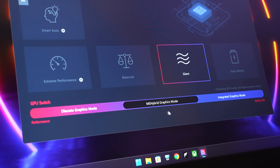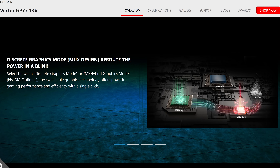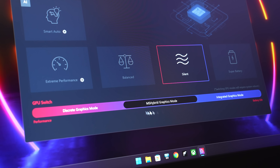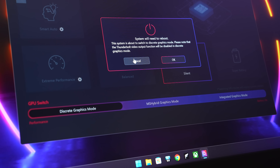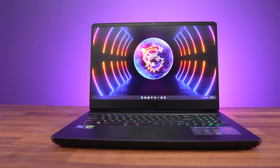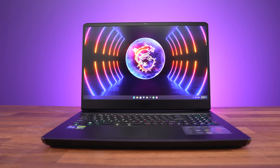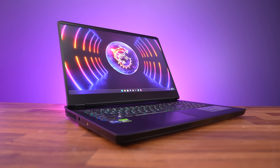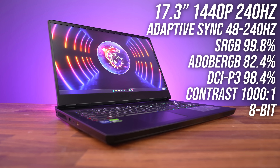The GP77 has a MUX switch, and MSI's website notes you can reroute power in a blink with a single click. This might be true if you hold your eyes closed for more than 30 seconds, because it does not have advanced Optimus — so you need a reboot to swap. There's also no G-Sync, but this is meant to be a cheaper model with less features compared to their higher end GE series. There is adaptive sync, but only when Optimus is enabled, as the integrated graphics handles that.